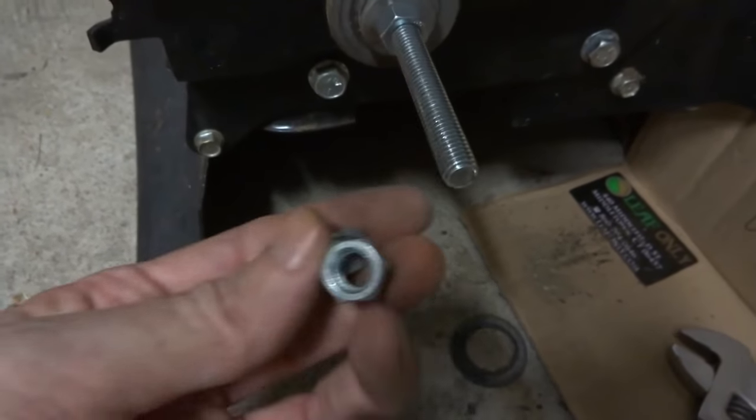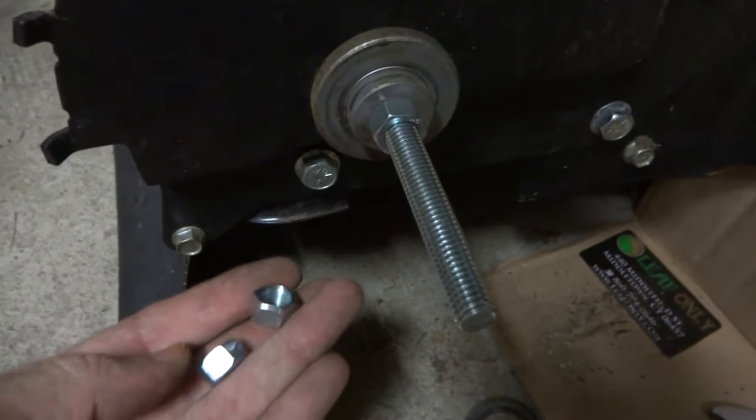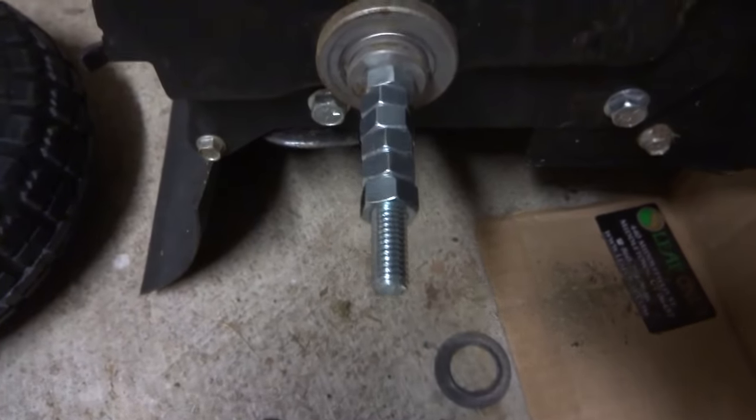Got it all tightened back up. I got my new longer three and a half inch bolt in here — this is a three-eighths by three and a half inch. What we're gonna be using out of this stuff that you took off is this piece right here. You see how it's got that inset — that's gonna get rid of this piece sticking out here a little bit. So put this on here that way, then run a three-eighths nut all the way down and tighten that up, then get the rest of these nuts and thread them on.